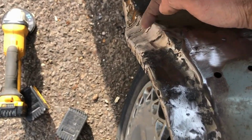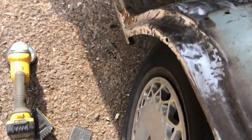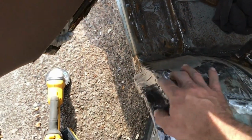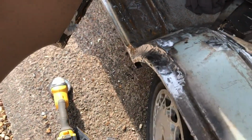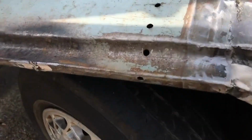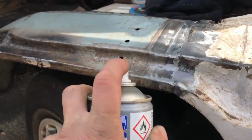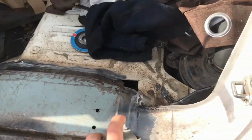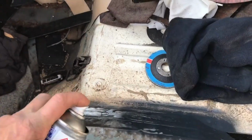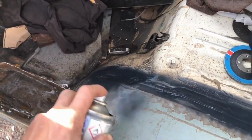Yeah, it's getting there. A little bit more filling, sanding to do. They left quite thick welds. At least there's something. There's some meat in there, so I can sand those down. I know it's still gonna be sanded back and treated and everything, but just as a guide coat, how it looks when it's painted. Sometimes you think it needs a lot more, but by the time you paint it, it's actually not too bad.